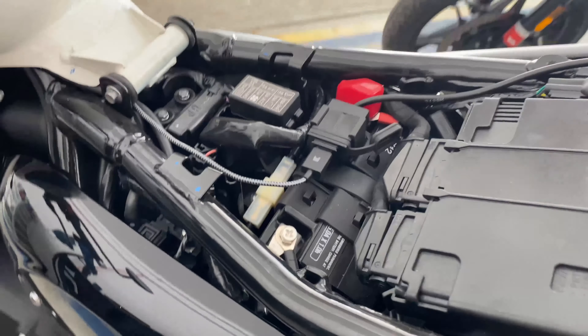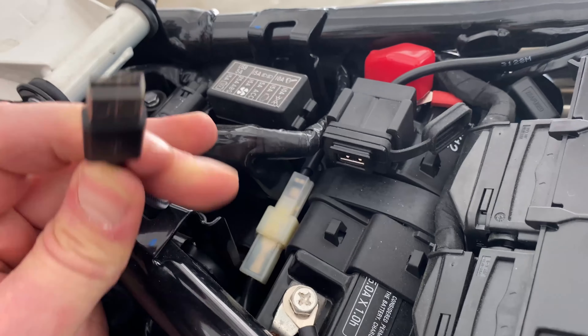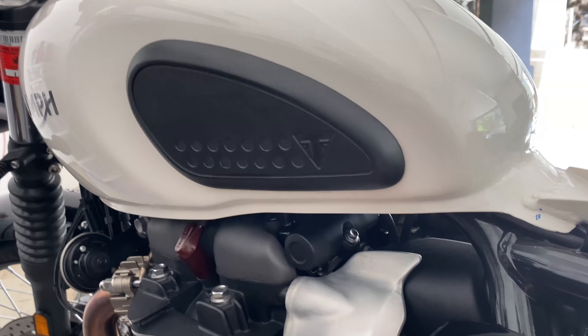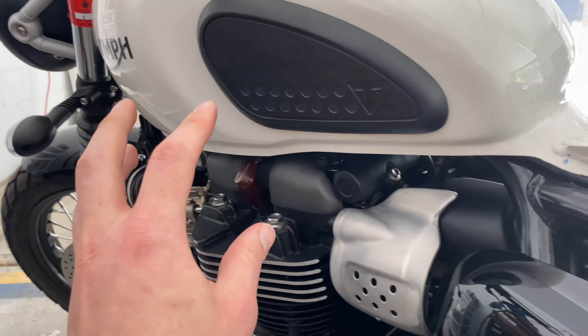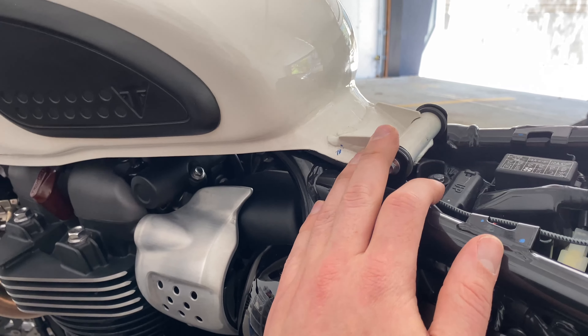If you're installing a USB accessory on your bike there are a couple of ways to do it, but on the 2019 Street Scrambler they actually have a USB port built in already — no fuss, just buy the wire and run it where you need to go. What I did was run this wire all along here, up into a nice plastic conduit inside that protects all the other wires. I tucked the USB into that conduit to protect it from the elements. You can do the same — just remove the tank.